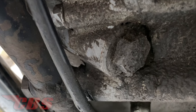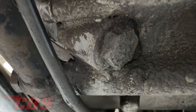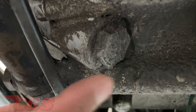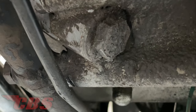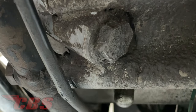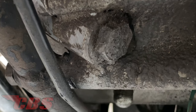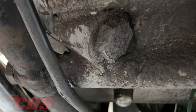We are at the bottom side of my TR6 engine. As you can see, it's really dirty down here, which is normal — we live on a dirt road and everyday riding will look like this. I do recommend that you clean it before you take the plug out. Some of the later ones or 500 unit constructions are going to be a different style, but it's essentially the same thing. If you remove this plug, there's going to be a copper washer or O-ring depending on the year, and there's going to be a filter. Once you drop that, there's going to be oil in the crankcase. This is a dry sump, and oftentimes there could be about a cup of oil left behind. Once you do that, clean the filter and put everything back on.